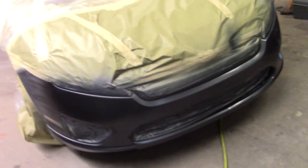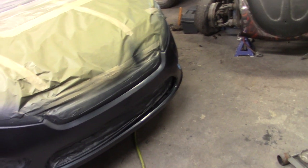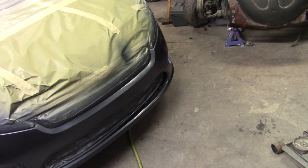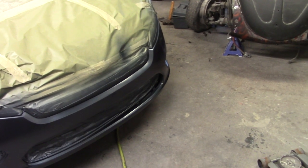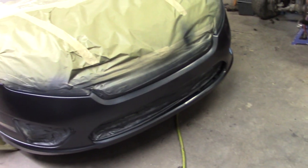Okay, we got a little bumper job here. I'll try to set you up on the can cam. I based it out with some paint I had in the cabinet, getting ready to hit it with some of the paint I got at the paint store. I bought 4 ounces, which was $8 and some change. So give me 8 ounces sprayable, and that'll be enough to cover up this base I put on here and get the color match. We'll clear it after this and we'll be done with this one.